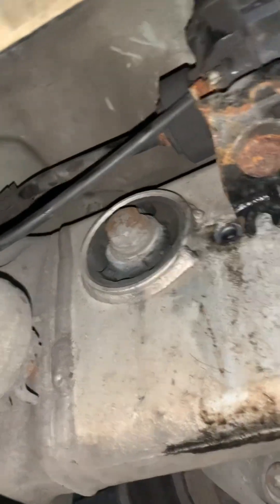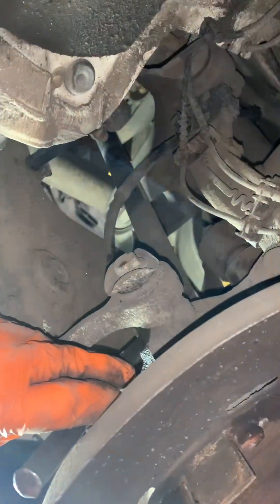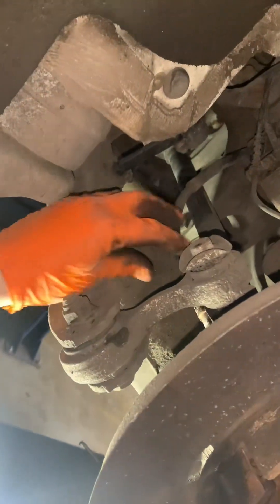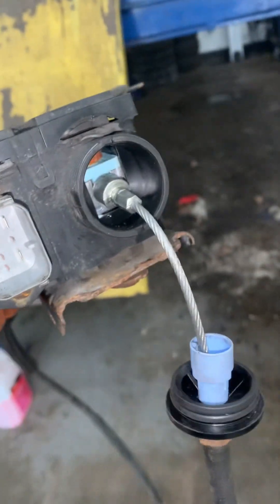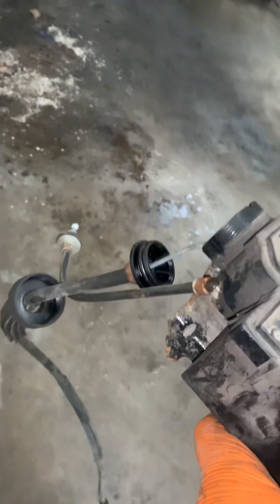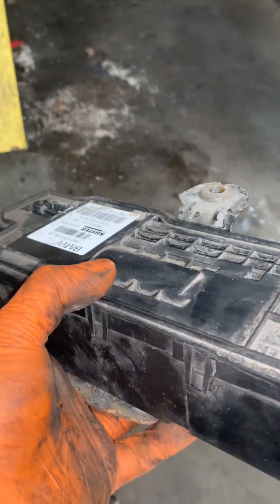Now it's just a case of pushing the handbrake cables through the hubs because they are quite seized and it is not fun. The tried and tested method that works is a flat chisel. We had to unscrew the caps on the driver's side - you can actually remove the whole handbrake cable which gives you enough room to swing it down. This side we just undid it to give a little more free play so the cable's not under full tension.